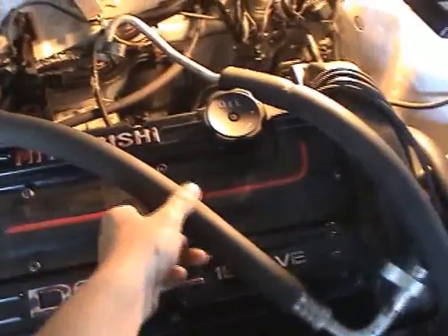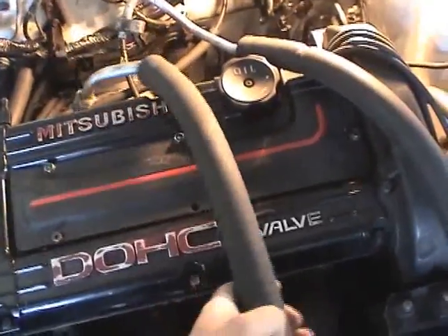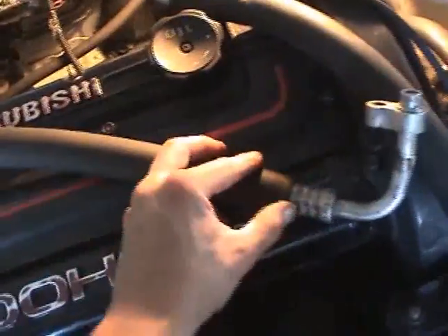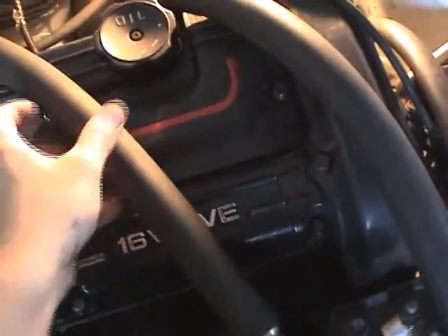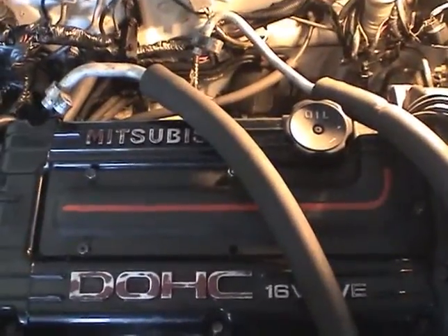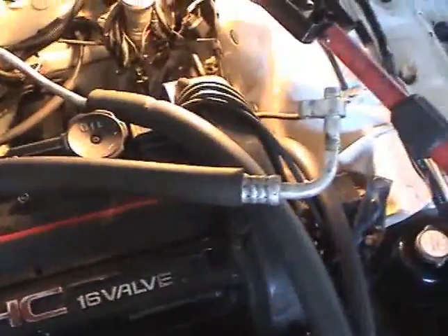These two hoses are the flexible hoses in the AC system. When you convert to R134A, it's recommended that you upgrade these to a barrier-style hose — apparently the molecules in R134A like to leak out of the rubber hose designed for R12. I'm going to just leave them as they are and see how the system works, kind of going for the cost-effective switchover. This hose is the same between the 1.5 liter and the 1.6 liter.